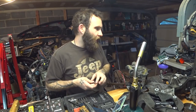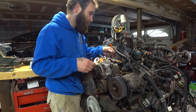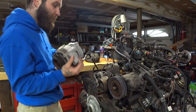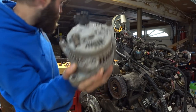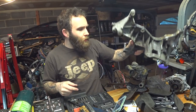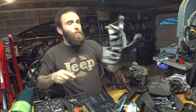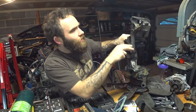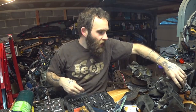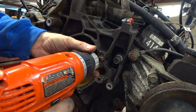The alternator certainly is going back on. That was held on with like 43 bolts — two of them were seven millimeter. Alternator is out. Seven mil bolts on those little posts back there — who puts a seven millimeter bolt on anything? I tried the quarter-inch stuff. Got this big gaudy bracket off. In the process, I did snap the first bolt on the 5.2 carbureted 318 swap project. What happened was it was a steel bolt, the aluminum bracket did the dissimilar metals dance — they went ahead and seized on in there. I was drilling it out, giving it the heat miser, getting it sprayed down.